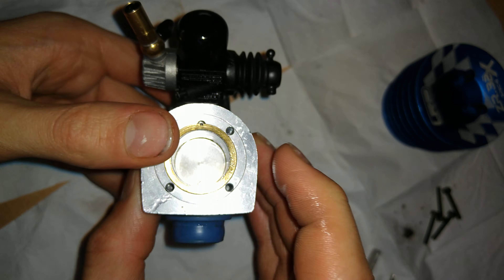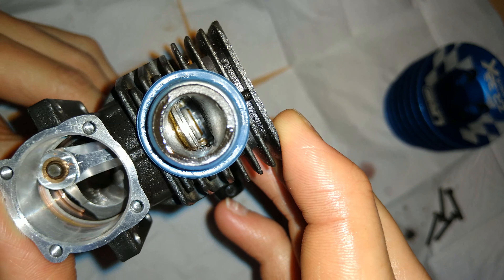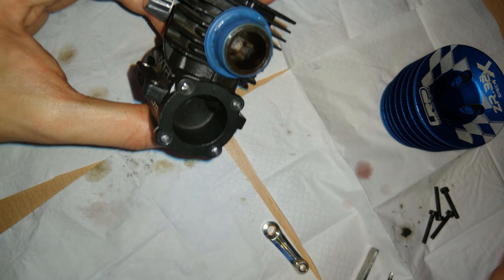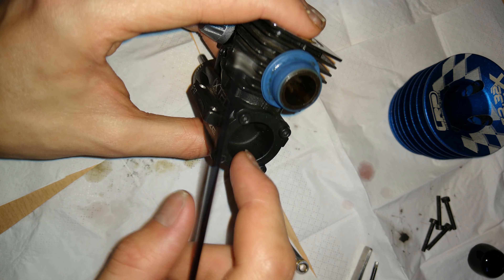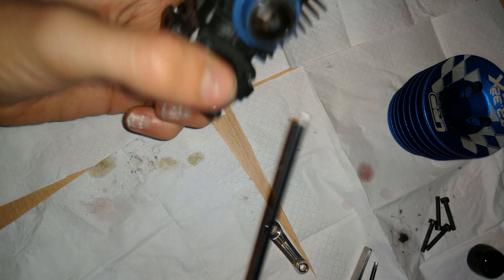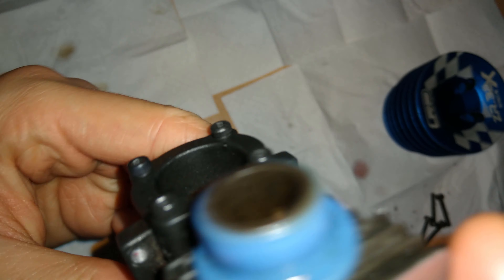She is installed — there we go. I'll put some more after-run oil on there to keep her nice and shiny, no rust anywhere. Now it's time to insert the back plate. Make sure the piston is up, otherwise you might damage the piston skirt as it hits the plate. Get your back plate screws — doing these snug right now, not fully tight. Also, do this without the exhaust piece attached, otherwise you might build pressure and the sleeve lifts up. Push it down, and those two are tight. Back plate is installed — check the edges to make sure it's sitting right, otherwise an air leak will make tuning impossible.